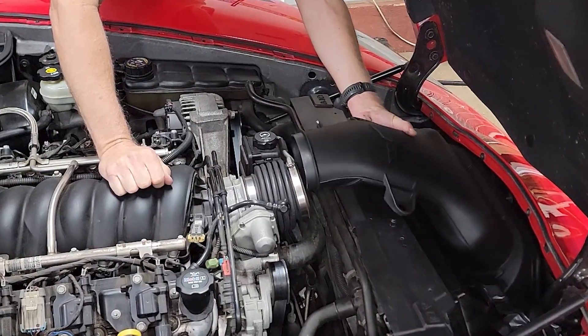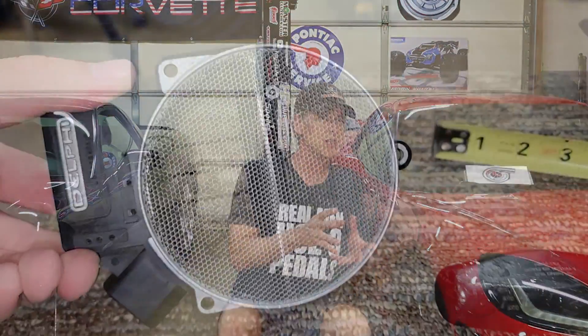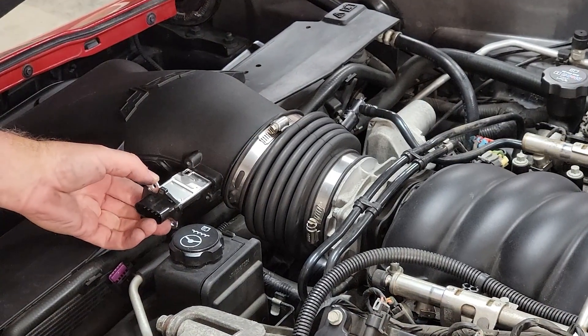I went through the effort to install the wideband oxygen sensor on a temporary basis in the C6 so that I could adjust and optimize the LS2 engine's tune for that complete LS7 air intake assembly — which not only includes the new air filter element, but also replaces the stock LS2's fairly restrictive mass airflow sensor with the newer card-style mass airflow sensor.